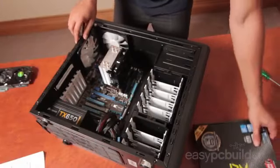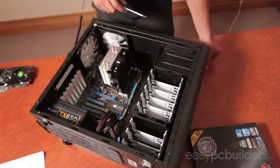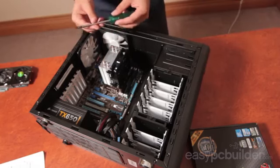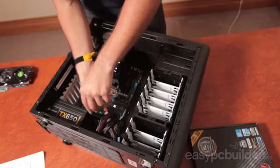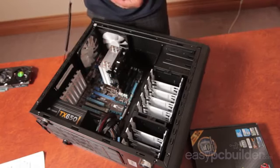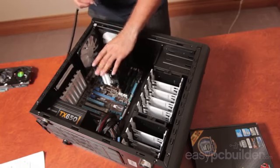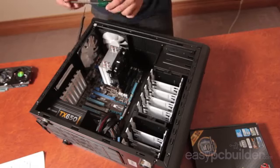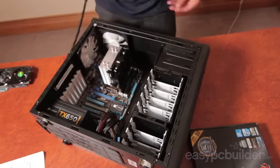So then we're on to mounting the motherboard. There are specific screws to do this, so check your case manual, and then install the motherboard screws in a diagonal fashion, loosely at first, until you have all in place, to ensure that you don't torque the motherboard if not initially mounted correctly. Then, when you're happy with their placement, completely do them up and you're in business.